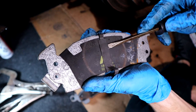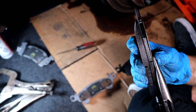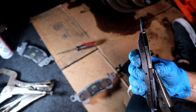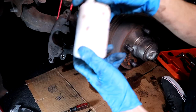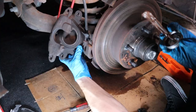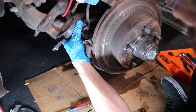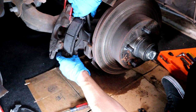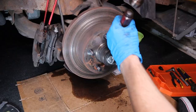Here are the new brake pads. Take off the backing plate off the old brake pad — just do that. It's a tight fit, so we need to wedge it on with some needle nose pliers and some love taps. Knock it down to the center of the brake pad. Here's some copper anti-seize — I'm just going to place it on all the contact points on the caliper. Then just snap the bottom caliper in with some clean gloves so you don't touch the brake pad.